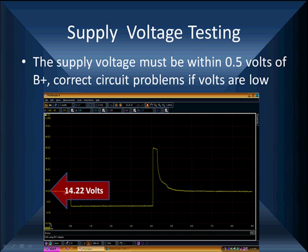All of the stuff we just looked at, none of it was visible in scan data. Scan data gives no clue as to how high the voltage spike was. The scan data gave us no clue of how good the ground was.